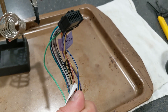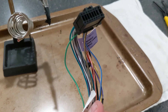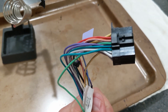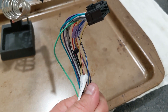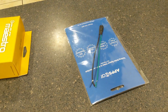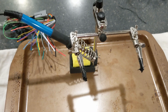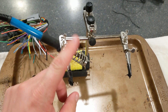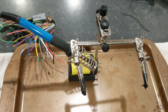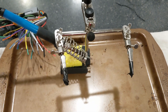In your stereo box, you should have been given a wiring harness — it'll look something like this. For the most part, the wires are not going to be labeled as to what they go to, but luckily it's mostly going to be matching wires with the same colors. We're going to be going through each one. There are a few things we're adding because we're putting in this in-motion adapter to allow us to use the stereo while we're driving. I personally like soldering all my connections — it isn't necessary, but I think it gets a better connection versus a crimp connection.